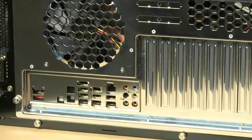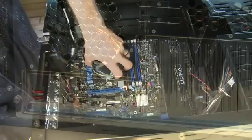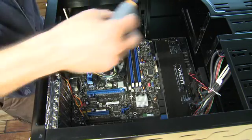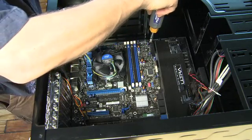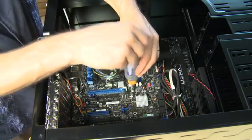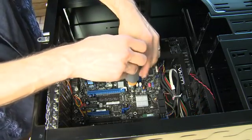Then, when you put the motherboard in, be sure to line it up with those holes. Position the motherboard carefully over the screw holes, then use your screwdriver to secure the motherboard in place against the standoffs you've just installed. Secure everything into place, but don't crank down too hard because you don't want to break the board.